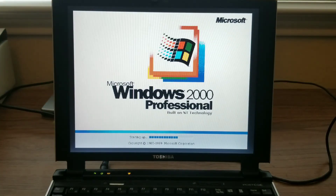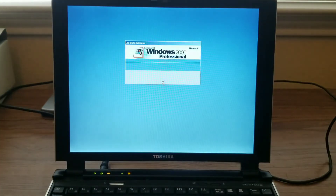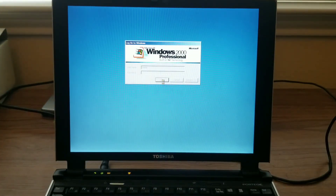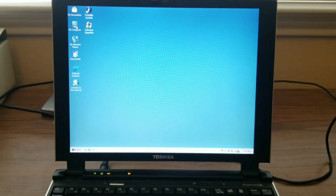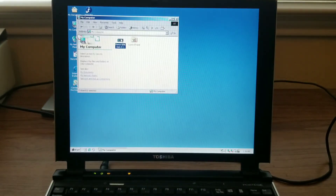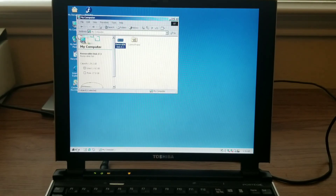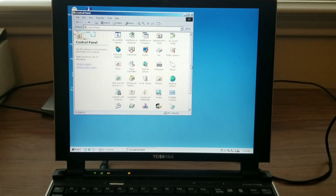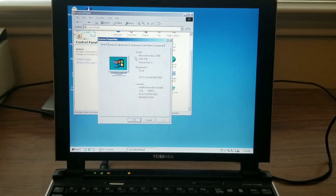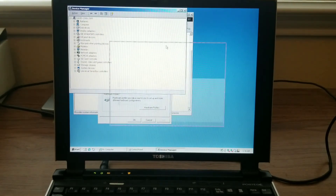Now why is this useful? Assuming you have an old laptop you want to keep using, laptop hard drives are usually the first component to go bad. In addition to being a delicate device with moving parts that are sensitive to physical shocks, the hard drive itself wears out, with a lifespan of most drives rated at around 5 years. By comparison, solid state storage is much more durable physically, and good flash storage from a reputable brand will last a long time.